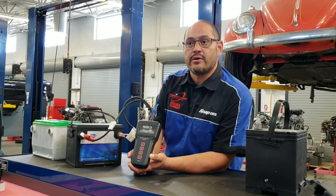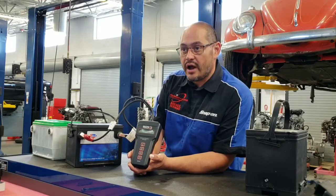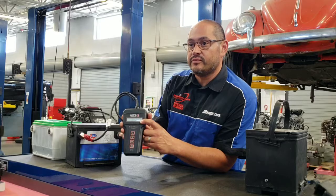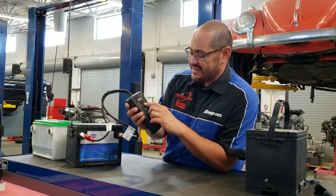So that means is this battery good to test? Yes, because we want at least 12.4 volts or higher before we perform our tests. Once we know the state of charge is good, we follow the prompt in the right corner. I hit the plus symbol and select to test the battery.